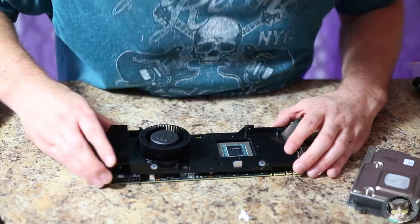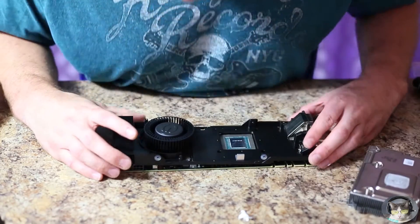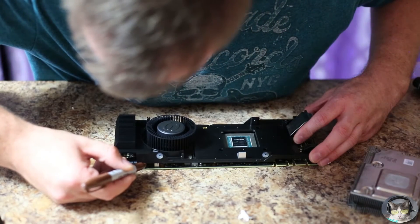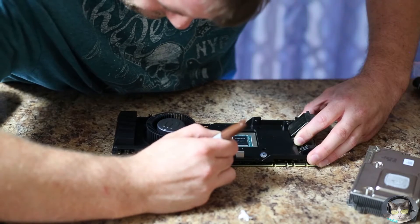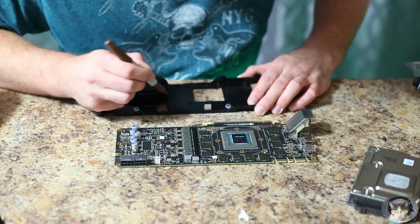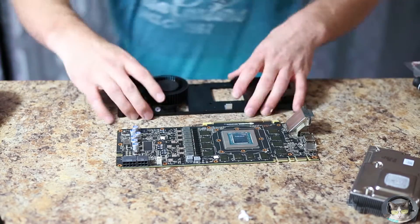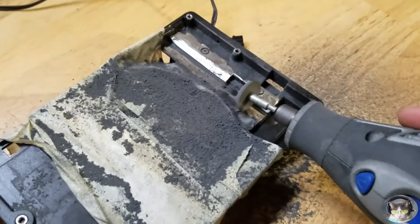Here I'm cleaning off some thermal pads since I intended to replace them. This is the 1080/1070 base plate - just checking it out and lining it up. As you can see at the bottom, closest to the camera, that little silver VRM is going to be in the way. I'll line this up the best I can, grab a marker, and mark out what I need to cut. I went to the garage so I didn't get metal shavings all over the house - I used a large tin snip, though I'd recommend a small hacksaw blade for a finer cut.